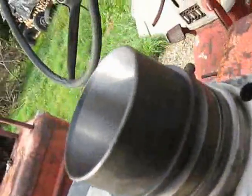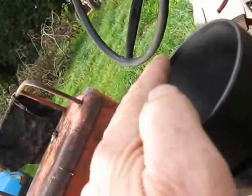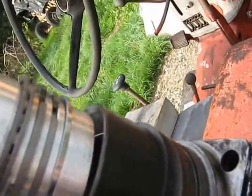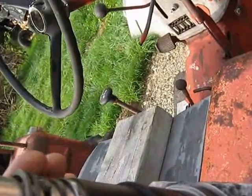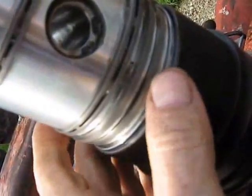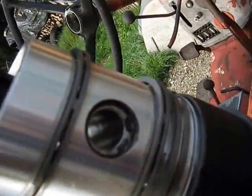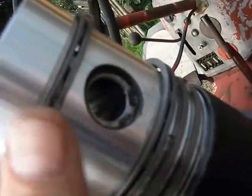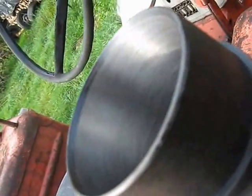Now this has a taper in the top here, so we can put the piston rings in here carefully. Squeeze them in with a thumbnail — not a screwdriver. If you use a screwdriver to work round that you will break it. So lots of oil on the rings, and they will push in there with your thumbnail, working them into this taper. And you shouldn't break any.